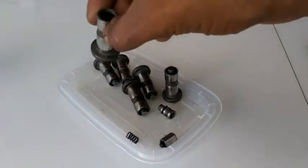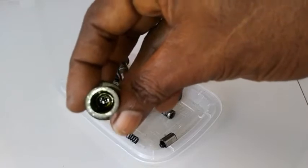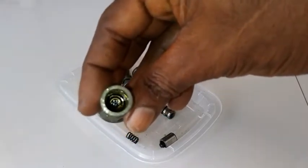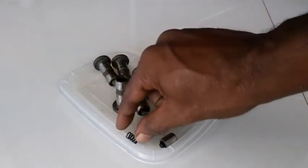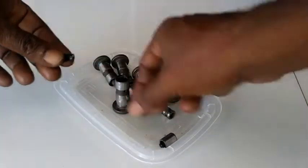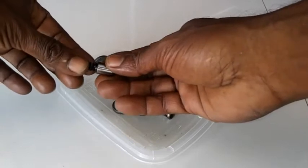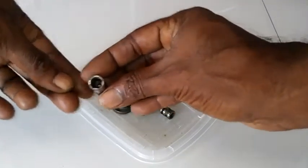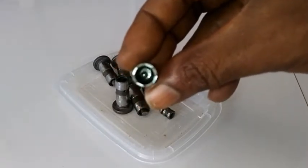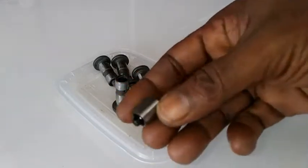This is one of the lifters that's taken apart. You can see inside there, down on the bottom, there's a groove, and that groove is for this spring to seat. You want to take some Vaseline or petroleum oil, motor oil, and put this spring together like this with this plunger. You can see in that plunger, there is an orifice at the bottom, and on the other side of that orifice is a ball.